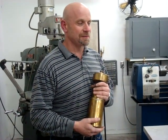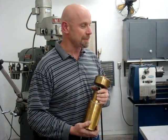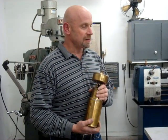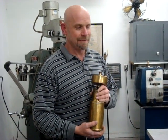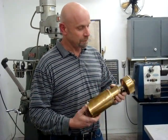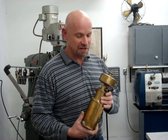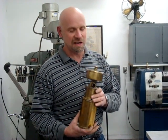This is a copy of the first engine that Daimler made. It was a high speed engine capable of running at 800 RPM, one of the very first engines that ran on liquid fuel, with hot tube ignition. It had a lot of very first-of-a-kind technical features built into it. What I'm going to show here is the flash carburetor system used on the engine, because it was very hard for people to see what was actually happening inside when it's all assembled.